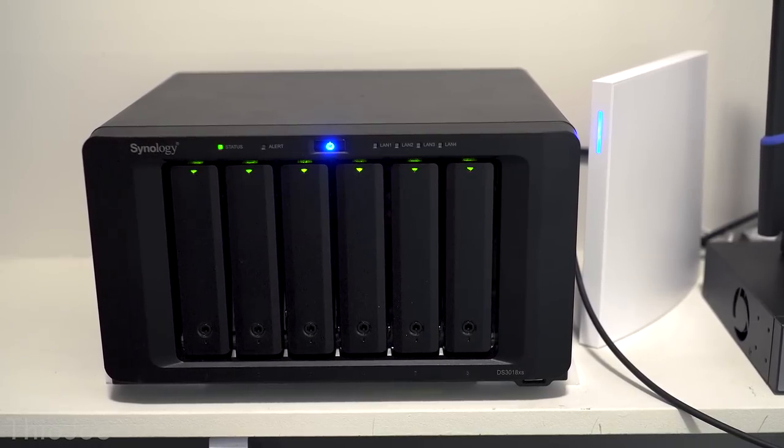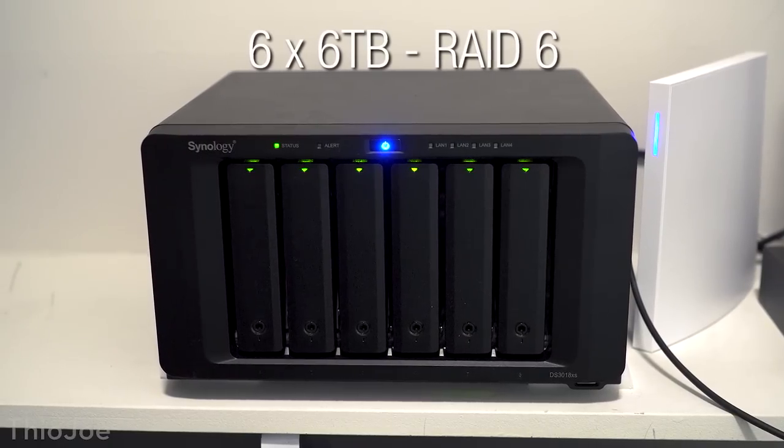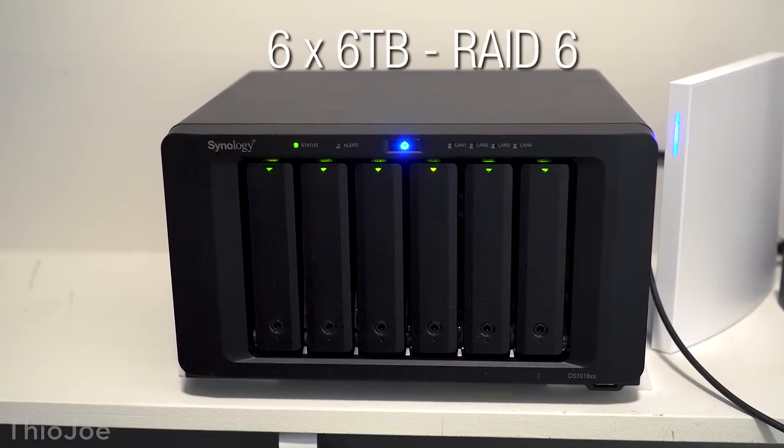The other device in my case is my NAS network attached storage server, which has six drives in RAID 6. RAID 6 is not necessarily as fast as some other RAID configurations, so that was another factor — if my NAS server wouldn't be able to do a full 10 gigabit anyway, then maybe Cat5e would be able to do enough to practically max out the connection, where Cat6 wouldn't even matter. We can look at the results later.